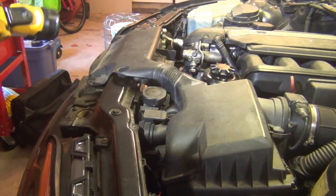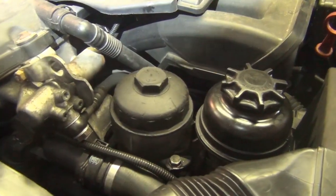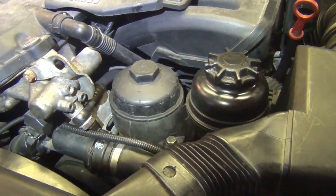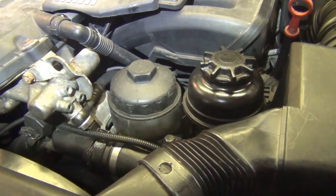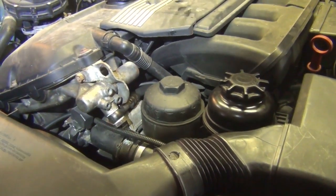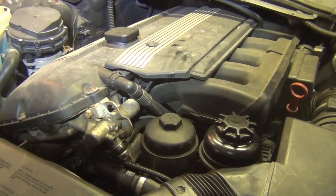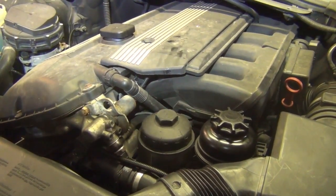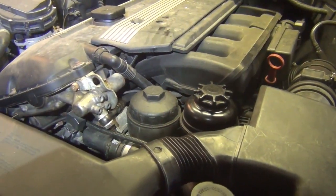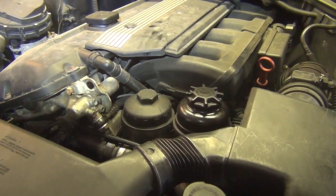You can clean off the excess oil that was in the line. At this point you can degrease the engine, run it for a little while, and make sure you're not leaking from the aluminum crush washers. That's it — it's pretty simple and should be relatively quick. Unfortunately it's kind of in there so it's hard to see everything and making a video of it is a little difficult, but I hope this is helpful. Thanks for watching. Please remember to subscribe. If you can think of other videos on a 3 Series E46 with an M52TU or M54, let me know and I'll do my best to make a video — a subscriber recently wanted this Vanos line done and said he couldn't find a good video on it, so I went ahead and made it.